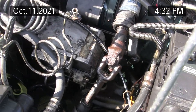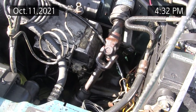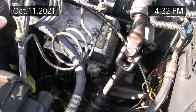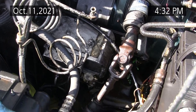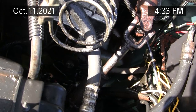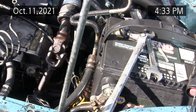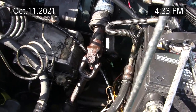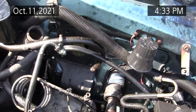I'm doing this video so I know the sequence, which is to start with the two outboard ones, left and right. Then you move to these spiraled ones, which are on the left. Get those out of the way so you have room to do the remaining two or three, which are all 14mm. Then you've got four big bolts that hold the ABS to the bracket that comes down from the Hydro Boost.